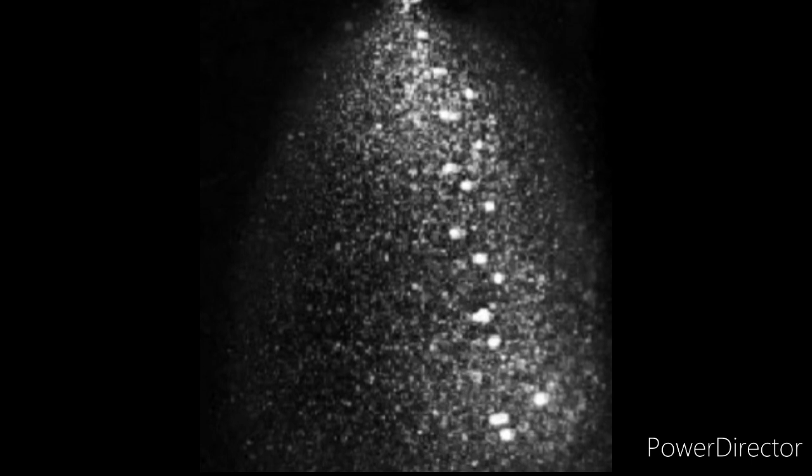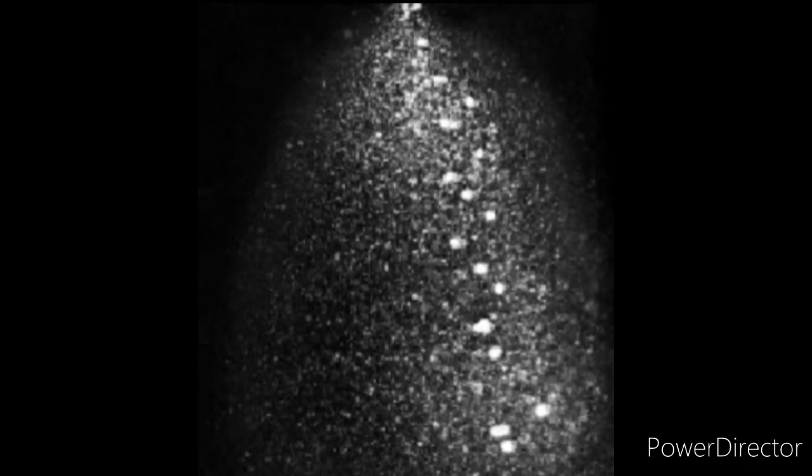This picture shows a non-shrouded air injector, and you can see the larger droplets of fuel. So it's non-shrouded. The next picture is with it shrouded, and as you can see, that's like a mist of fuel that can mix with the air so much easier, to give a nicer, even combustion.